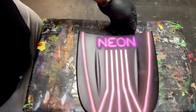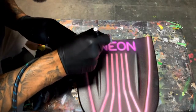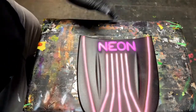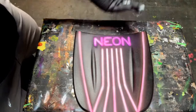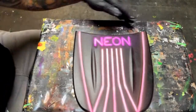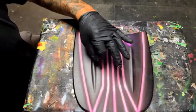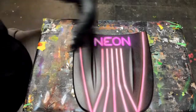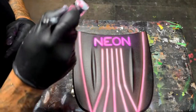They just asked, is there a secret to peeling that tape? I can never get mine 100% clean. Go light coats of paint around the tape, because if you try to flood it out and paint too fast, then you're going to bridge over your tape too much, and it just causes a lot of problems as far as getting a clean edge. So take your time, reduce your paint out more, and you should have less problems.